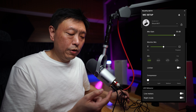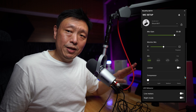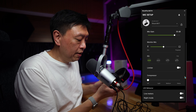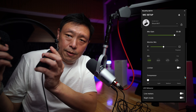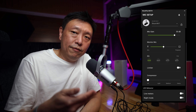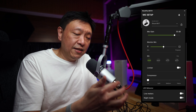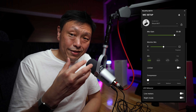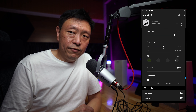The other end can be USB-A or USB-C, and both cables are included. When connected that way, you can monitor your input via a pair of headphones, which can only be driven when connected via the micro USB port. If you're just using this as an XLR mic, then you won't be able to hear anything through the headphones because nothing is powering the circuitry to drive them within the Shure MV7.